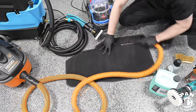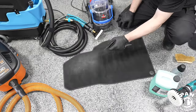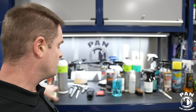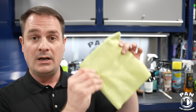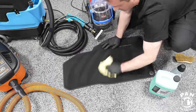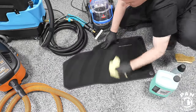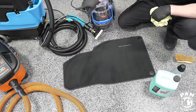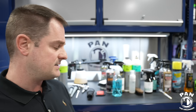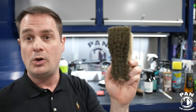The first order of business is always to vacuum the carpeted floor mats first to remove the majority of loose dirt and debris. Once that's done, spray your all-purpose cleaner or carpet cleaner generously on the surface. For entry-level you can rub a microfiber towel — I like to use the Rag Company Edgeless 300 towels for interior use — and blot that away, which does a great job.